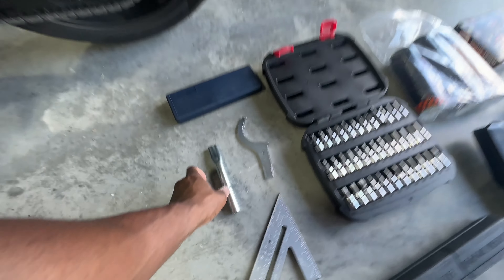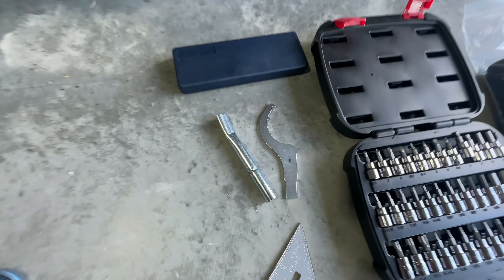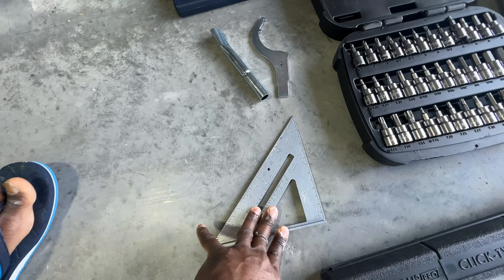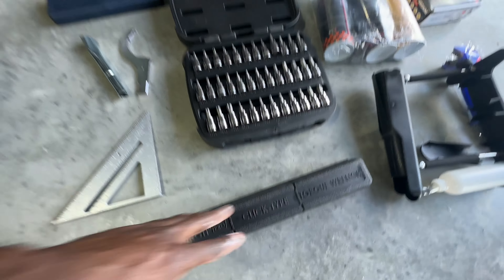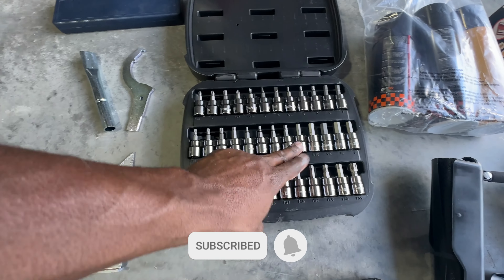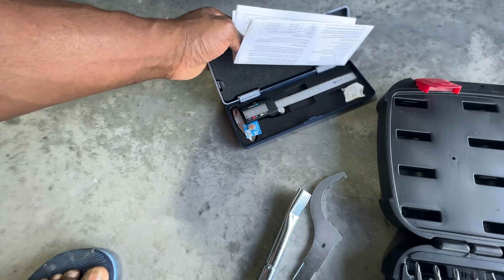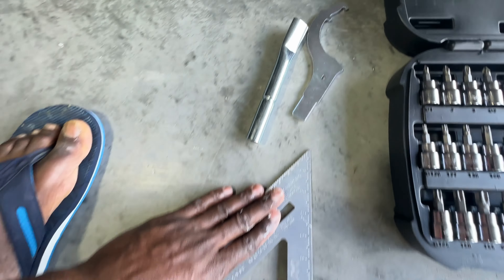For this job you're going to need a couple of tools — not exactly what I have here, but something similar. You're definitely going to need the spanner tool, which came with the CV1000R. If you don't have it, I can drop a link in the description. You're going to need a ruler to measure the actual distance, a torque wrench to tighten your bolts back up, and some Allen heads with a three-eighths or half-inch drive. I believe it's a six millimeter to loosen it, but I'll show you when I get there.